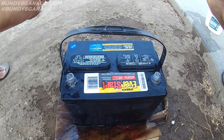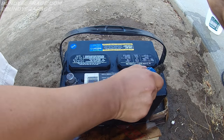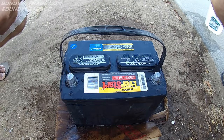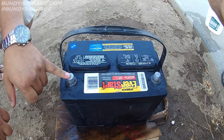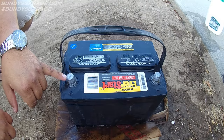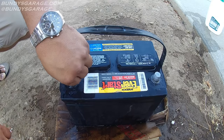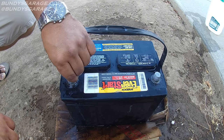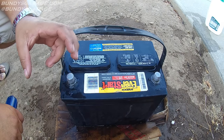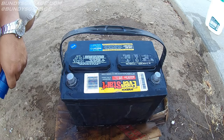Pull out the Christmas tree and work the top. On some Honda and Acura applications, the positive battery terminal cable is actually smaller than what the ringlet is on the cable. So they sell what they call a battery post shim — you put that on top, then put the battery cable on top of that, and it basically makes the battery post just a little bit wider so the ringlet can actually secure onto the post. I'll put a picture of that up right now.